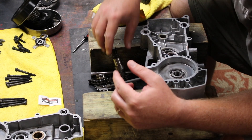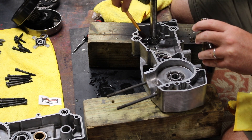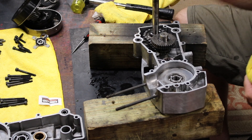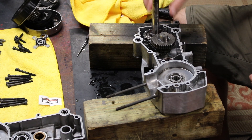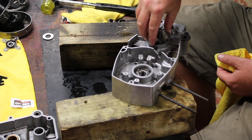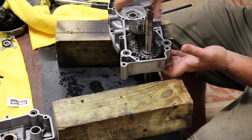Alright, let's put it back together — washer first, the short side in, get that little ring gear so it's locked by the casting in the case. Then I put in this other unit as a whole, just slid it on, and a tap-tap-tap to put it into place. Now I flip it over and put the other gear on. On the other side: first a spline washer, then the gear, then another spline washer, then the little split washer, then screw it together. Make sure it spins nice and free.